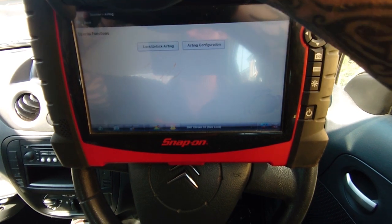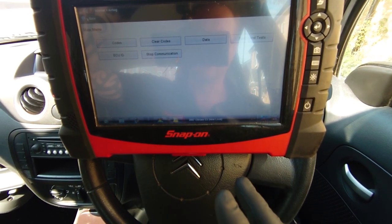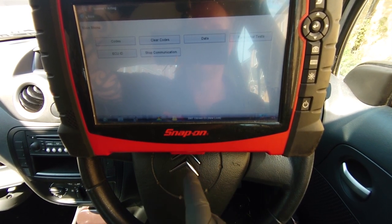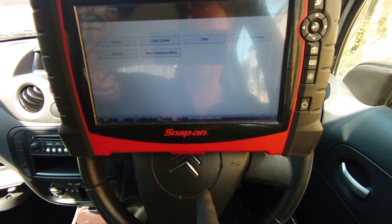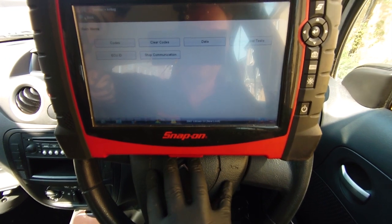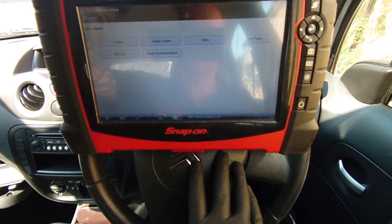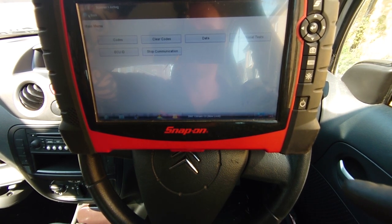Let's come back out of that. So I think what we're going to have to do is get into the steering wheel here and do a few checks. But a quick one that I do like to do, especially if I suspect something to do with the steering wheel airbag, is to see if other things work in here. So first one I go for is usually the horn — and we've got no horn. Now that's going to run through the same spiral cable on top of the steering column as the airbag wiring. So that takes me straight to it, thinking we're going to have an issue with that cable. But let's get it apart and do some testing.